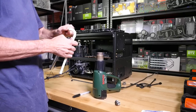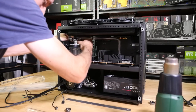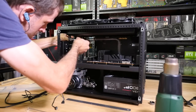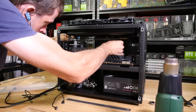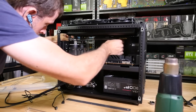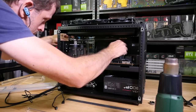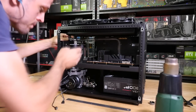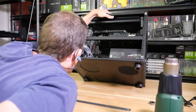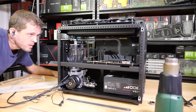So I'm just doing a section here. I think this one was for going up to the CPU water block. And yeah, I just didn't end up liking the look of it. Even though it was bent well, there was nothing wrong with the bends, I ended up opting for fittings just to get really clean runs on the bends. So just getting it all to 90 degree bends for this build, one 90 degree bend per tube instead of offsets or multiple bends. Now, if you're going to do multiple bends, it is definitely more challenging, but tube is cheap. You can just have multiple attempts, but seriously, the amount of time that you put into getting it right sometimes is quite a lot.